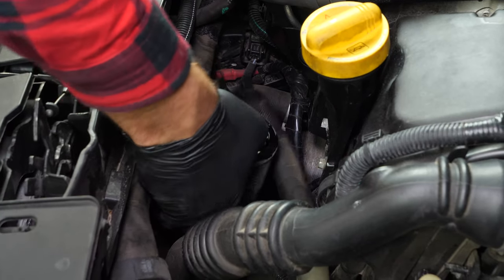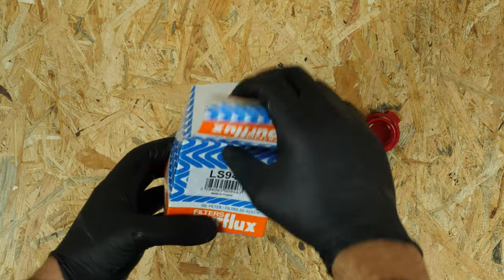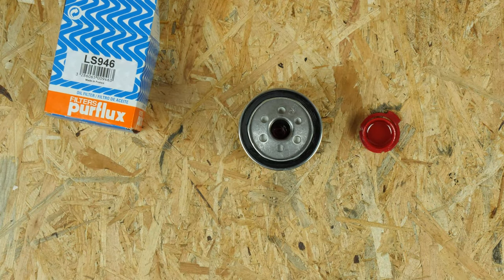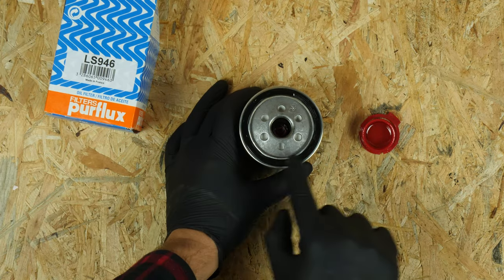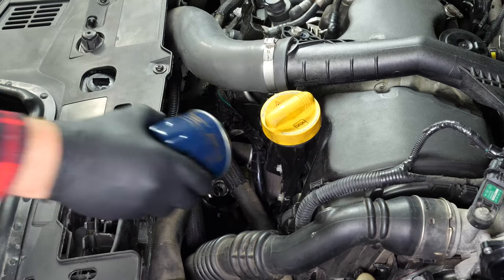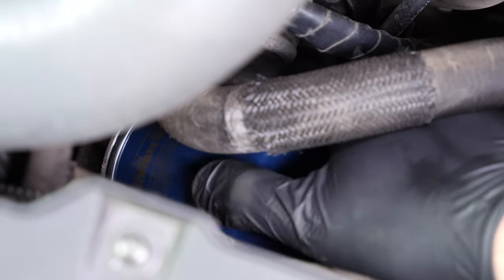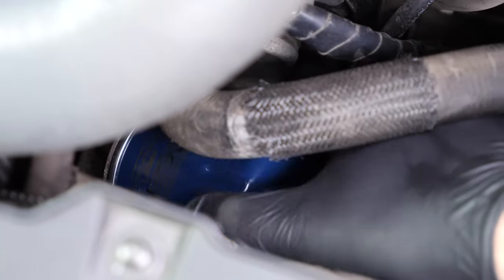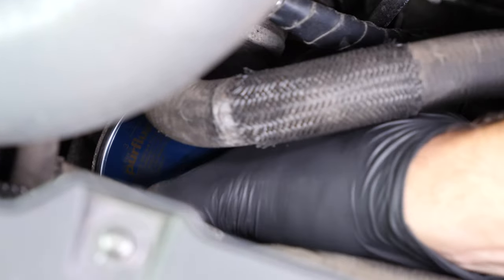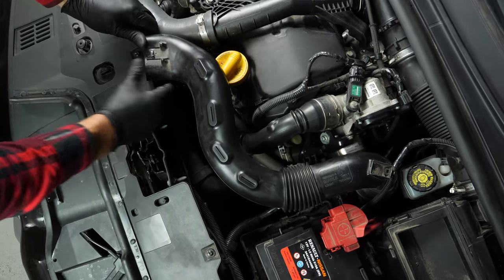When it has been released, turn it upwards to avoid spilling any oil. With a new filter in hand, lightly coat the seal with oil on the screw side. This will help avoid too much friction between the seal and the engine block — friction can reduce the seal's waterproofing, and coating with oil also facilitates assembly. Rescrew the filter until you feel contact, then take it fully in your hand and add an additional half-turn to tighten. Put the hose back in place and reconnect the air inlet conduit.